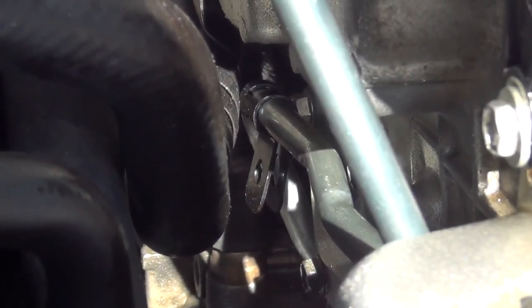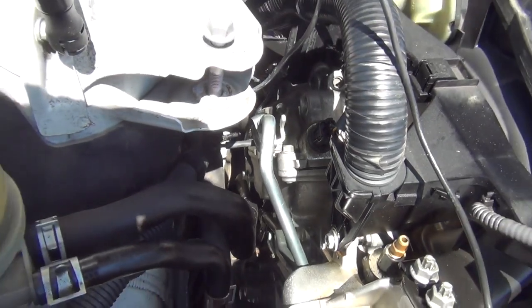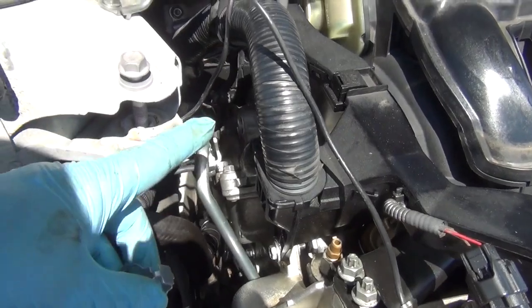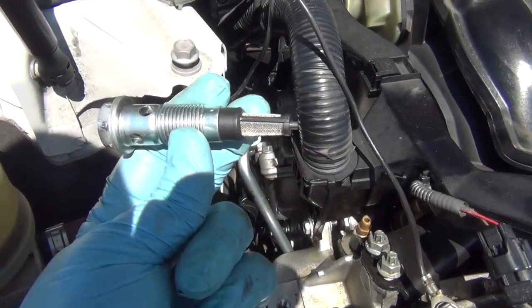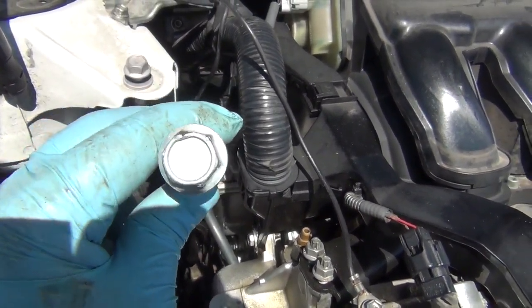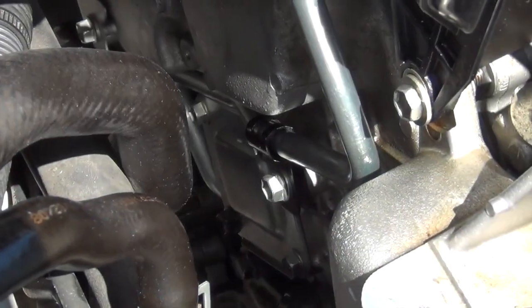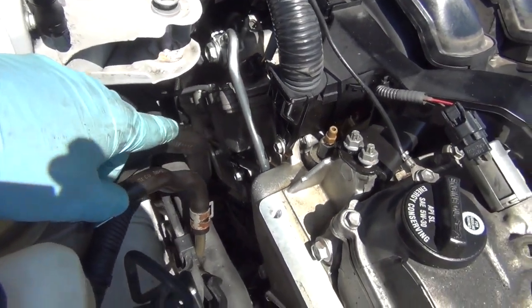All right, so there's that bolt-down strap. I cut it off the corner so it wasn't binding, because what we're going to do is fish the bolt into the top, get it started. Make sure there's a washer on each end. This one has a clip washer so you can't not have it that way. Then just line it up. Make sure the basket's on the end of the banjo bolt after you've cleaned it out like so. Then fish it into the head. Again, this was the one that was on the bottom of the block and it got rounded off. I've got a lot more direct access to this so I won't round it off. We've got that finger tight now. The bracket's in place with the bolt in it, and I just need to get a wrench on there and snug it up. You don't need to go to town on that.